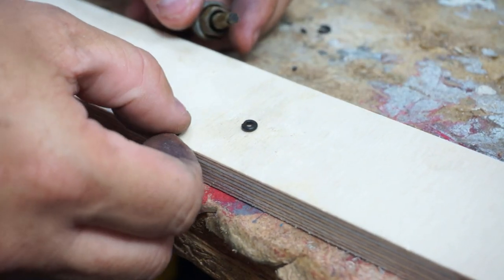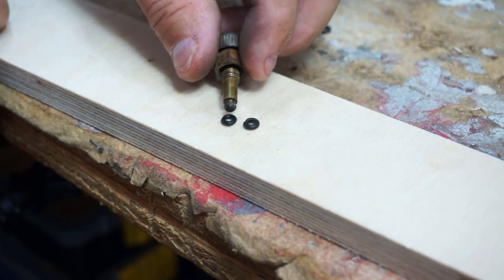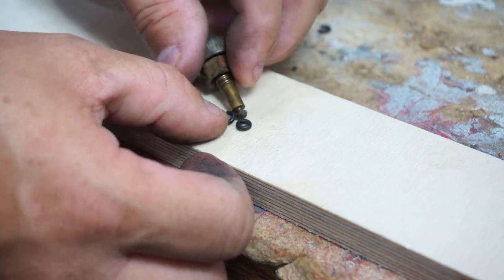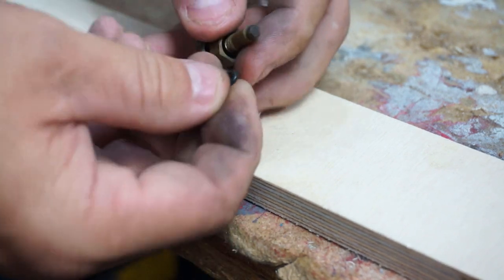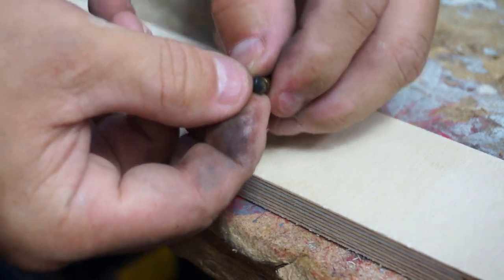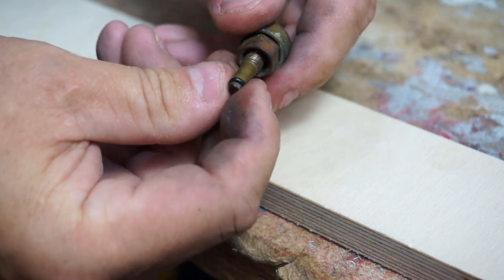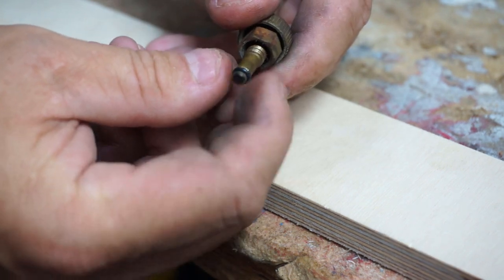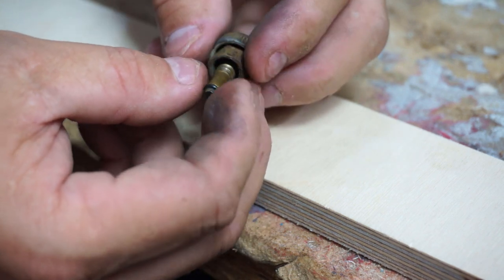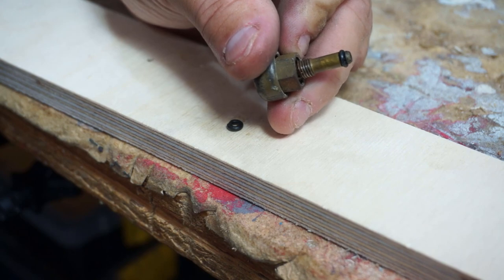Okay, that's been about two minutes or so. Here's our new one — the one we cut and made — and here's the old one. They're pretty close. As long as we can get this around the top without breaking the CA glue, we should be in business. So that's pliable, it's on there pretty good. We just need the final test to see if it leaks. That's how you make an O-ring when you don't have the right size.